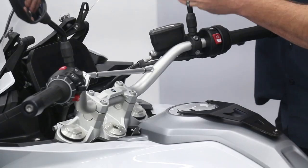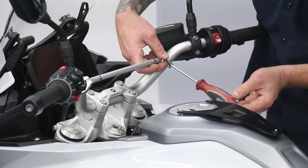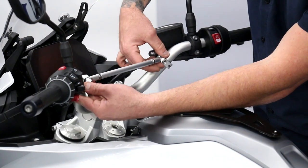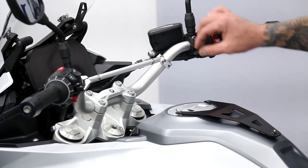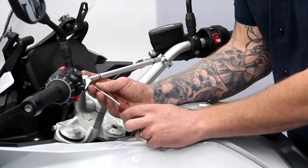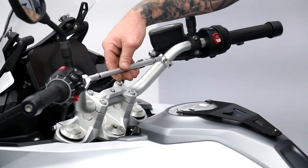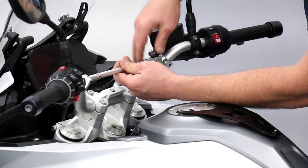Go ahead and reinstall them. You'll notice when you get it on, this is a turnbuckle here, so you can really get a full adjustment on this thing depending on which way you turn it. We probably want to go a little taller, so just loosen up the turnbuckle and get everything straight. Then go ahead and tighten down the pinch bolts on the buckles. With the turnbuckle we can add a little tension, then lock these nuts in place — they just require a 13 millimeter open end wrench.